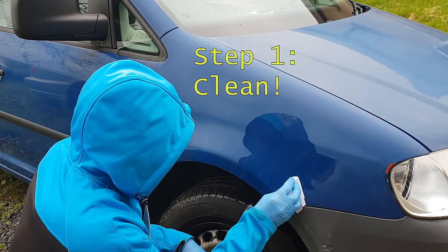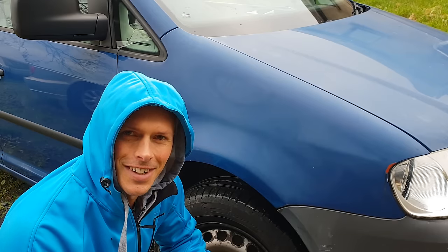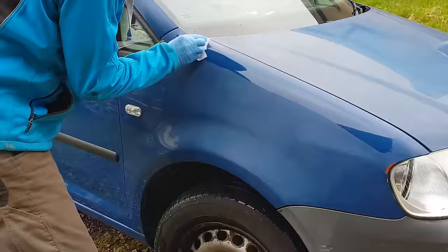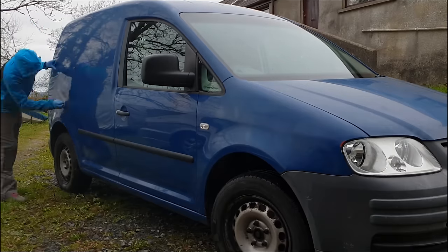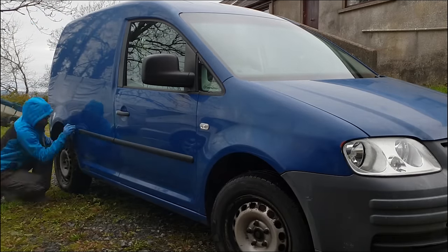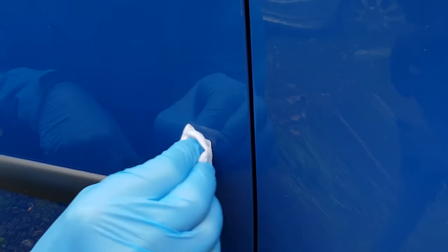So what I'm doing now is using some of this panel wipe down degreaser to get rid of any spots of tar or grease on the bodywork before I do the orbital sanding. For this exciting job I'm using a standard panel wipe, a wax and grease removing solvent, and if it's any help I'll try and leave links to all the materials I use down in the description below.